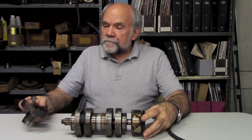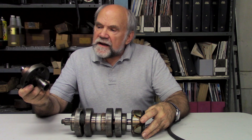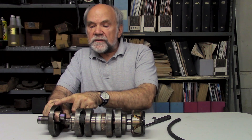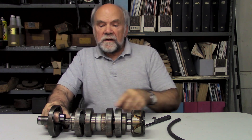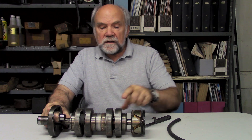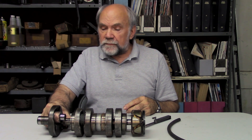When the RD400 came out in around 1980, it had larger diameter flywheels. They were larger and heavier, and therefore they vibrated at a lower frequency, and when the mass of the ignition rotor was added, the vibration was quite considerable.